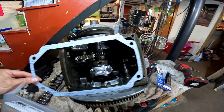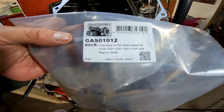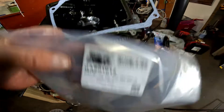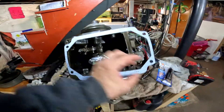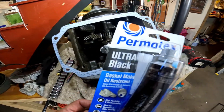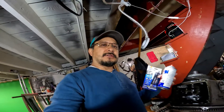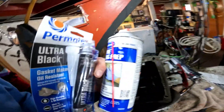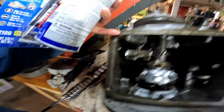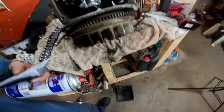There's a problem — I brought the wrong gasket. I bought GAS-01-12, saved as Kohler K241 wide base oil pan gasket. The wide base meant wider this way. I thought it meant it gives more room all the way around, but it's the wrong gasket. O'Reilly's saved me again — Permatex Ultra Black gasket maker. So I've got to make my own gasket right now.